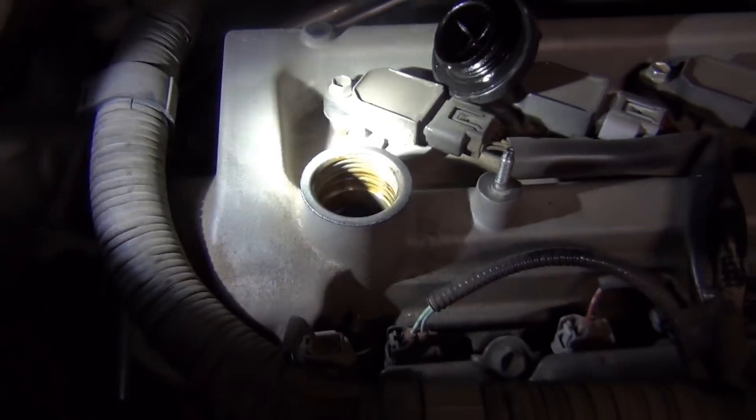At this point when you're getting the new parts, it's a good idea to take a look at your belt. You've got a few little shiny spots — those are rocks or gravel — not a big deal. Look for cracks and big rocks. You can see a little bit of cracking, but it's so micro, it's negligible. This belt's practically new. Pull the gasket off — I love when they do studs like these, they make it so much easier to put a gasket on. I usually doctor my gasket up with a little Permatex Right Stuff. I go through this stuff — I use it like Windex in the Big Fat Greek Wedding movie. I just go around this — it basically glues the gasket to the engine side timing cover and also glues the gasket to the water pump. This stuff's like chewy tire rubber — feel bad for the next guy that's got to take it off, but mine will never leak.